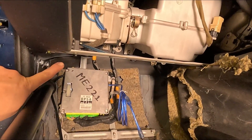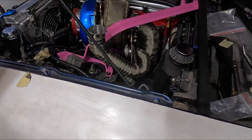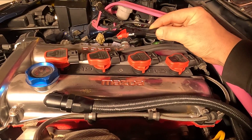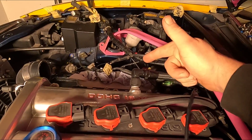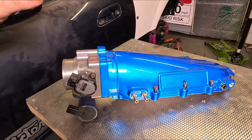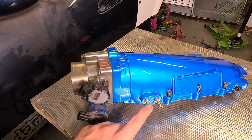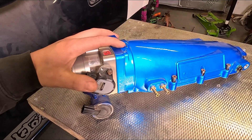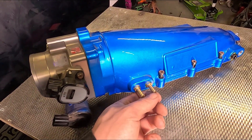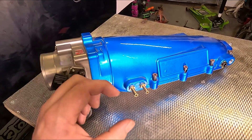So I'm going to feed it through the bulkhead somewhere up here, and I'm going to feed it through this wire and grommet just under the wiper motor. Then I ran that line neatly behind all these components and out over here. There's a little bit of red tape on the end to remind me what it is, but that needs to go to the inlet manifold. I'm using the Skunk 2 manifold, and that reference line can go to one of the front two ports here. Just make sure the line is nice and secure on these fittings, not kinked anywhere, and if you are going to use a cable tie to secure it, make sure that cable tie isn't pulled too tight to cut off the air.